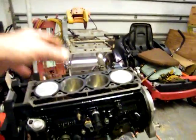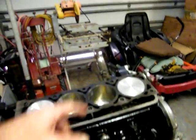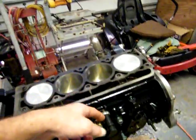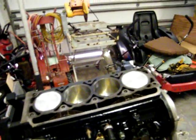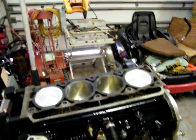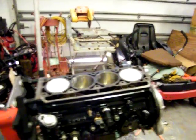When I put the head on I'll suck them all out, then put the head gasket on, put the head on, torque it down, put the pushrods in, put the rocker arms on and torque those down, put the valve cover on, and plug all them holes to keep air out. There you have it — peace.